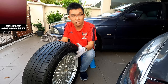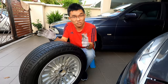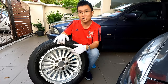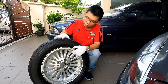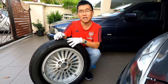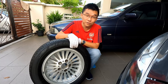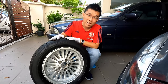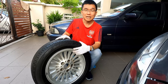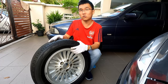When we talk about wheel sizing, 16, 17, 18 inches refers to the diameter. Wheel sizes have grown over the years — during the E39 era, 16 inches was normal, but today even 17-inch wheels on a five-series look rather small. The factory size of 225/55/R16 has become rare, which is why I went up to 17 inches on both my E39s, as getting tires in that size is difficult, costly, and the selection isn't appealing.